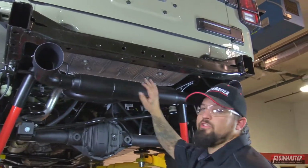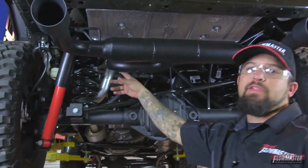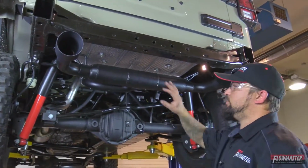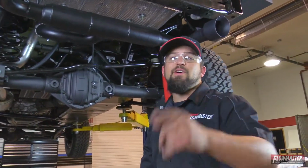Okay, that concludes the installation of the Flowmaster Outlaw system for the Jeep JK. This was an easy installation. It only took about 30 to 45 minutes. There's only one clamp that held on that stock muffler along with the two hangers. And then your stock muffler just comes right off. This one goes right in, and it gives a great, awesome, aggressive look to the vehicle with these nice black ceramic tips. I hope you enjoyed, and thanks for watching, and happy off-roading.